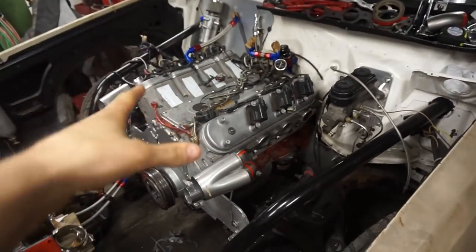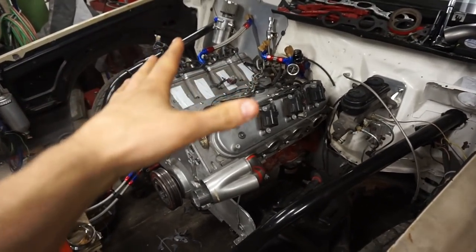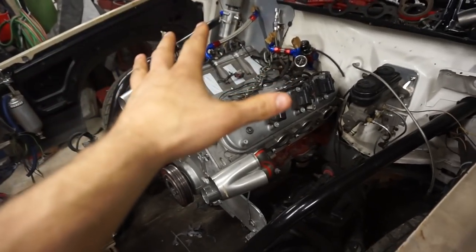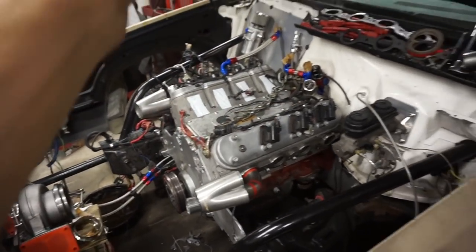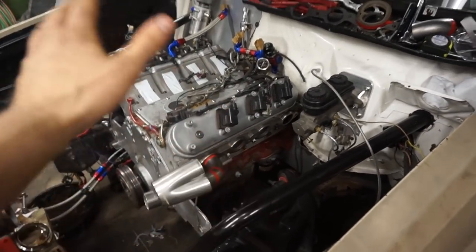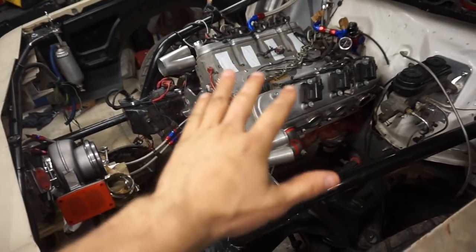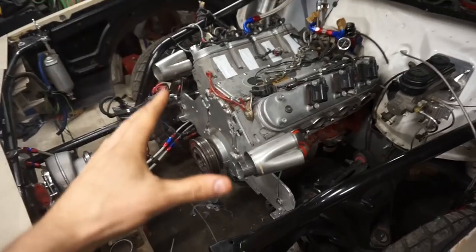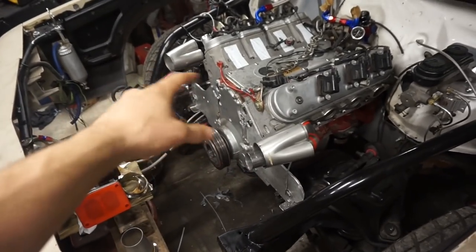You're going to get a quick sneak peek at my manifold setup. This setup I've had in the car for the past two to three years, so I already knew where everything was going to be — I wasn't going to move anything. So when I put the engine back in the car, I still had the factory engine mounts on it. All I did was set the engine back to where it's always been and built off of that — trimming my motor plates to fit inside the frame rails and building brackets off the frame.